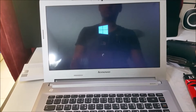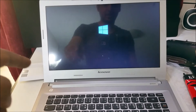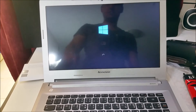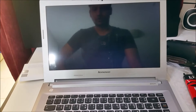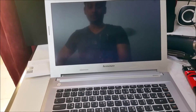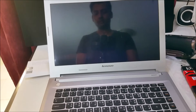First time it takes a little more time because it's configuring the RAM, so don't worry. Normally with 4GB it starts quickly, but now I've upgraded to 8GB — 4GB more — so it's taking a little time. This is normal for the first time when you upgrade RAM; it detects and installs the new hardware. Just keep watching the screen — it will come on.